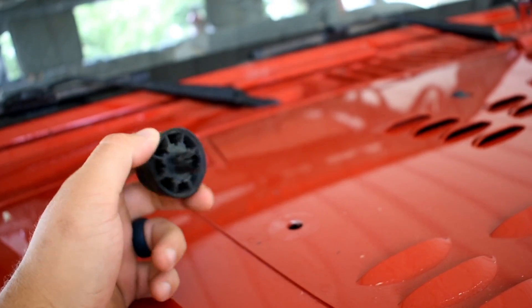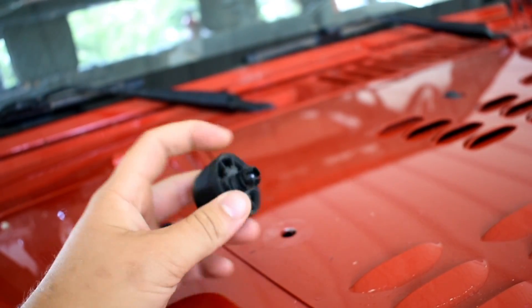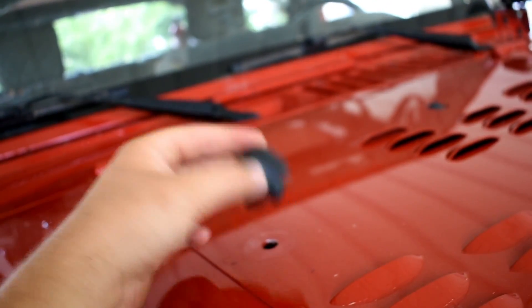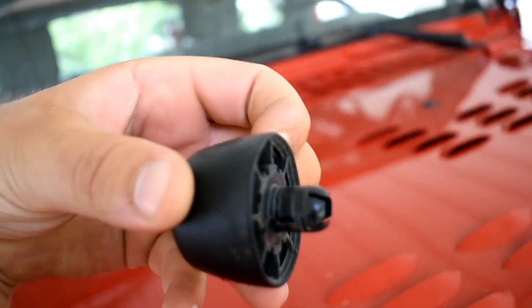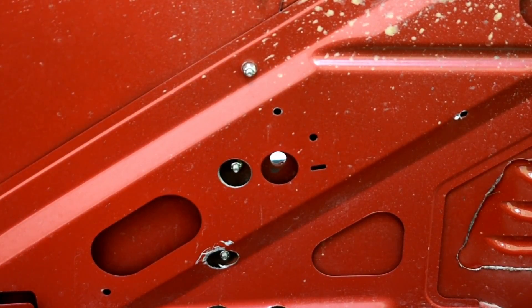Go finish smoothing this one down and throw it on the Jeep. The first step is to simply remove the factory bumps — all you do is kind of just twist and pull and they just pop right out. With the hood open, we can see where the hole is. We're simply going to grab our new hood bump, the washer and nut, and put it on.